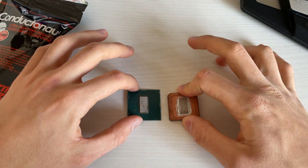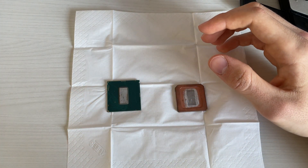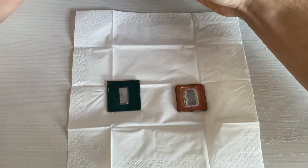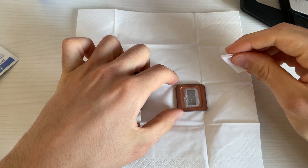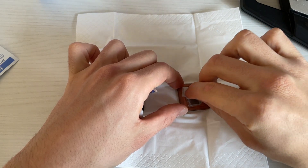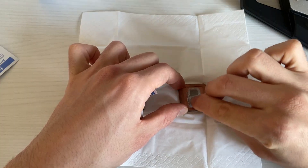I'll try to clean it off a bit with alcohol and then replace it. If you're doing this, you definitely want to have something under it because you don't want to risk damaging your desk. I'll get some alcohol wipes — you can use regular isopropyl alcohol on a tissue — and see how much comes off. Liquid metal can form an alloy with copper, which is what makes it difficult to remove. I'm not trying to fully remove it, just the parts that aren't flat. It's very hard to remove.